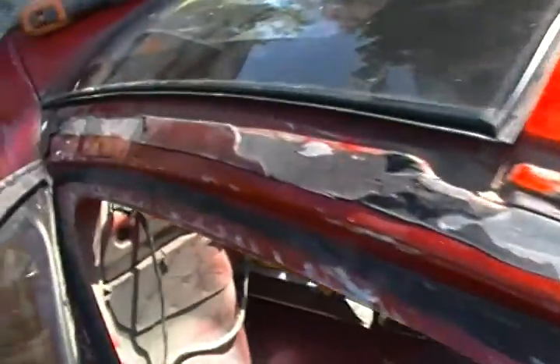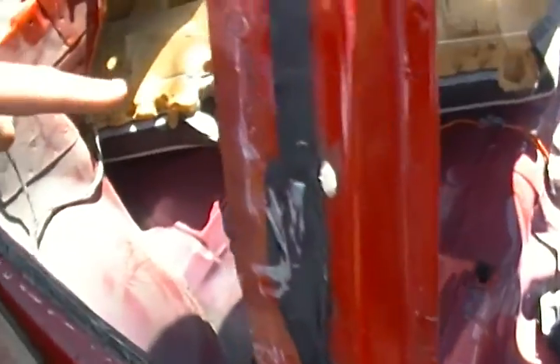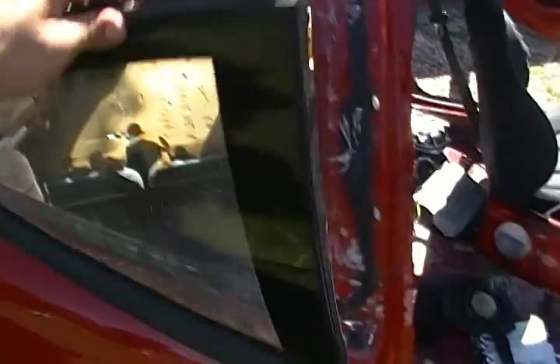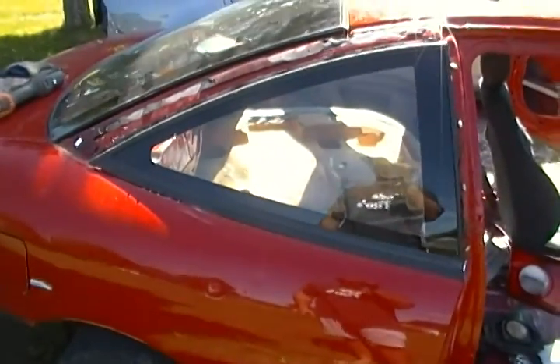I can confirm the oscillator works brilliantly to cut the rubber out. You can see I just have a little piece there hanging on before I cut it off to show you. Just carefully go around the rubber — I went on the inside of the car to get the bottom rack out, and carefully chiseled my way down with the oscillator. And there you have it: the window out completely intact, no glass shards — just what we wanted.